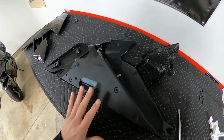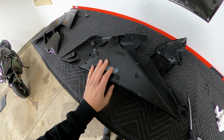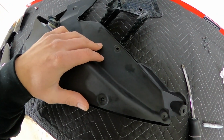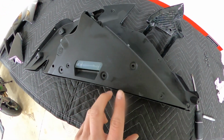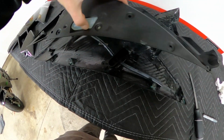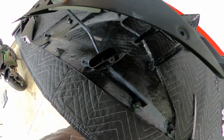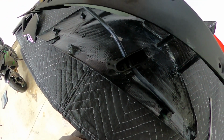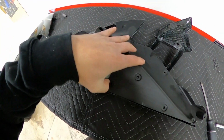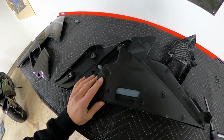Okay, so I've got this thing laying on the new piece. I went ahead and drained the coolant tank reservoir just to make this easier and less messy. I'll fill it back up. Everything looks to line up pretty decent with the exception of these two. And that is actually that bracket there. So what I'm gonna do is take those two loose, try to move the bracket over and see if I can make this line up to where I don't have to drill any of these or widen the holes out basically. But if I do have to widen the holes out, it's not a big deal.